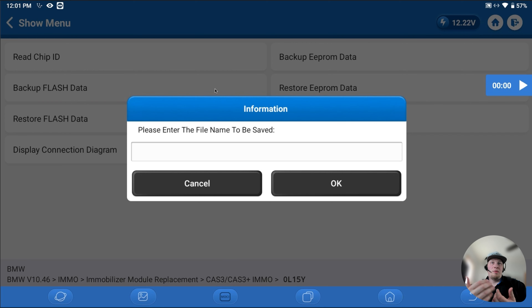When naming the file, I typically name it something like 'original CAS' and maybe the last six or seven digits of the VIN — something you can use to differentiate what file is what. You could use the date or the VIN, whatever works, as long as you remember. The key is to also place a suffix like V1, V2, or V3 when you make multiple reads of the data, so that when we compare the data for consistency, we know we have multiple unique versions.